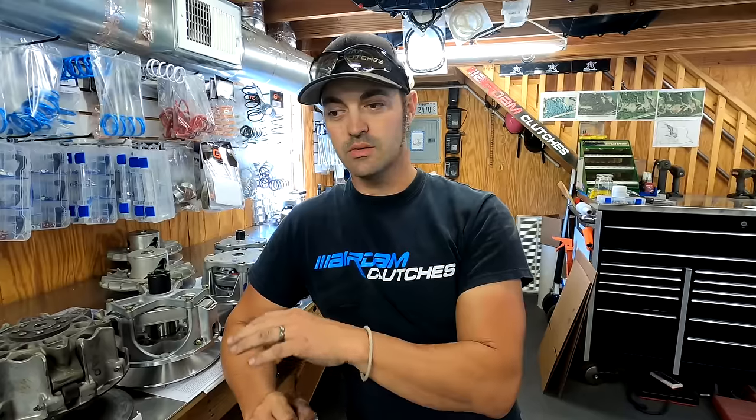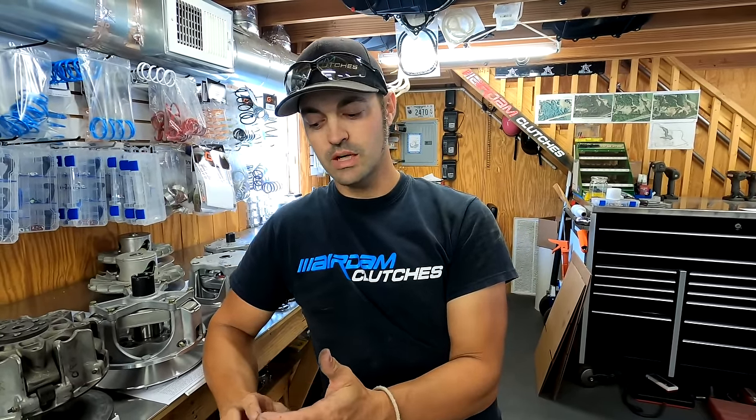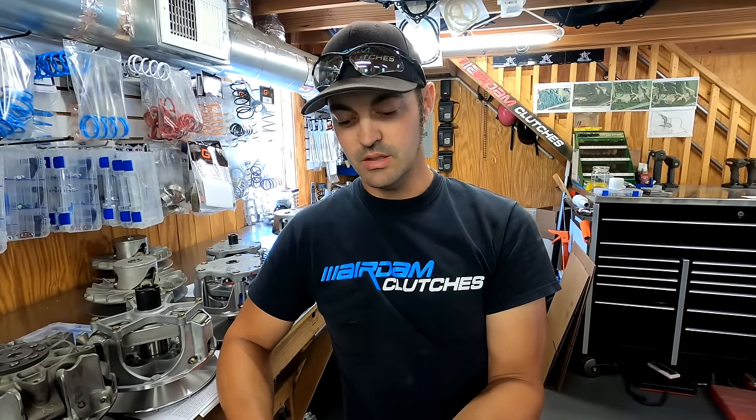And by doing these clutch kits, springs, weights, secondary, we've got helix options, we've got lots of different things, and each machine may need something a little different. So a guy with 26 inch tires that wants to outrun his buddy, we've got a drag race setup. We've got a different helix angle, a different secondary spring, a different primary spring and different weights. And doing that setup, you can get really good gains out of a machine, but not have any adverse effects. You'd get nice acceleration, fast top speed, cool belt temps, and the clutches won't be unreliable. You won't change the reliability whatsoever.